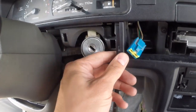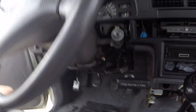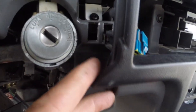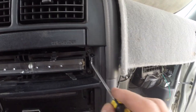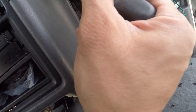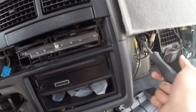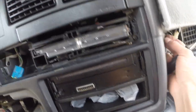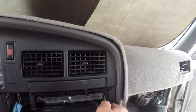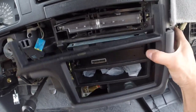When I was pulling my dash apart this piece started coming out already, and that's why I need to get it removed so I can get the clock placed in here. After you have that piece removed, this piece is almost free. There's a screw right up in here, and this clip already came out when I was pulling on the lower panel. There's one more in here — if you use a little pick you'll be able to get in and pop it. Get the screw removed first, then use the pick — there it goes. Just wiggle it around a little bit and it'll fall straight out.